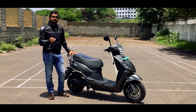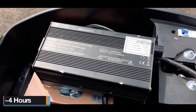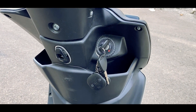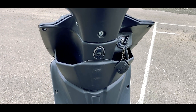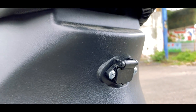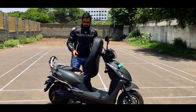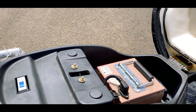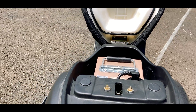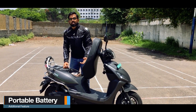Just like the ePluto 7G, you get two ways to charge the battery with the 67.2V 10A charger, and it takes around 4 hours to charge the scooter. Instead of a locked storage unit like in the ePluto, this one gets two open pockets to keep your stuff along with a hook to hang your bag. The external charger is below the seat, or you can switch it off, open the boot — and while there is no boot storage available here, you have small storage for a few items, but the major part is consumed by the battery. You can switch off the MCB, unplug and take out the battery, take it home and charge it.